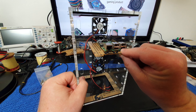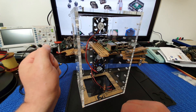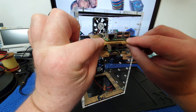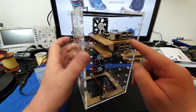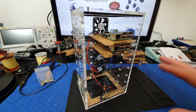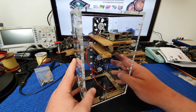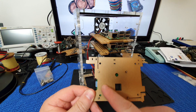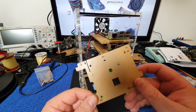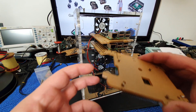Once you've done that, these cassettes are really easy — they just slot into the two holes down the end, and here you've got a little catch. Just gently push on that and it clips in, so now you've got a Raspberry Pi in there. If you want to add more, you can simply push another one in at the top. You could make something like a Docker cluster, which is probably where I'm going with one of them. I've got another case too — I'm probably going to do a Docker cluster and a NAS drive. There are four holes here and I'm rather hoping they'll line up with the hard drive holes.